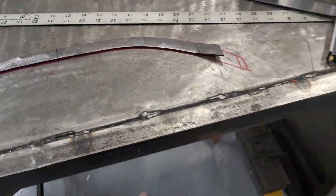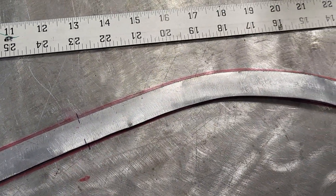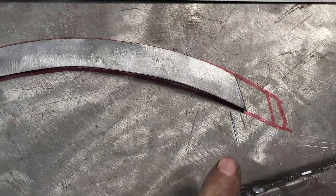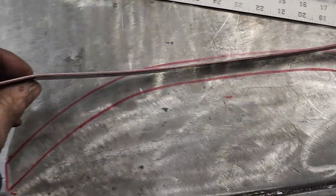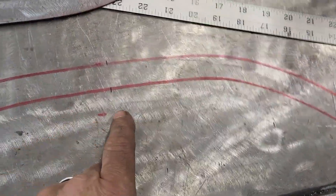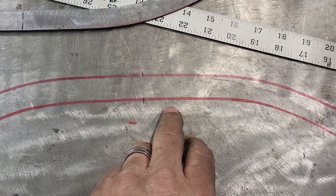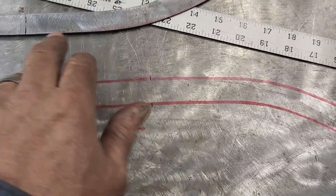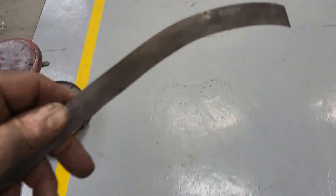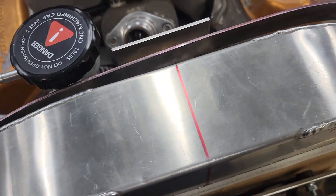Now I have an exact shape. I started rolling this but unfortunately it's sitting up — it's bent a little bit. I rolled the two edges a little bit. The other thing is: when you do that, mark center on your piece and mark center in here. If it shifts from your centerline to one side, go in between those two marks, make a new line, brake-clean it off, keep flipping it over, and you will find a very exacting piece.